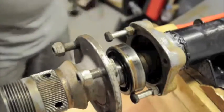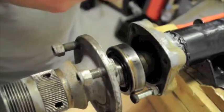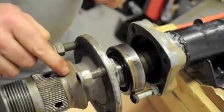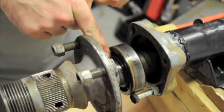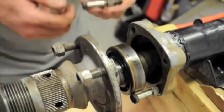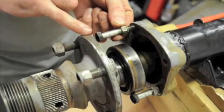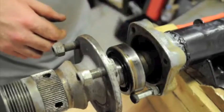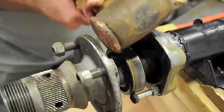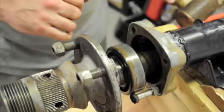So, unfortunately, you missed a bit. What happened was I wound it down. What I should have done was take it apart and adjust the length of these spacers slightly by winding it back up to push it out. Because what's happened is the hub has now mated with the collar here. So winding the castle nut in on the end wasn't making any more difference. So I needed to wind these out a bit. When I came to do it, it turns out these were so jammed up against the back face of the hub that I couldn't turn it to take these out. So that's where your soft face hammer comes in, and I just whacked it on the back edge, and eventually the bearing and the hub and the half shaft have all come apart in one piece.